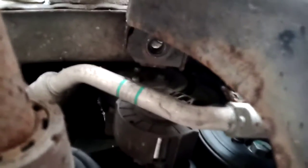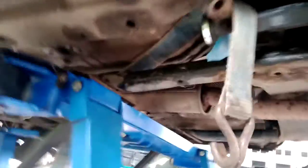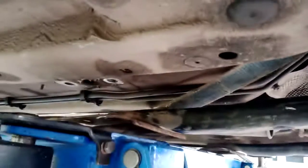You can just about see the hole there — where my finger is — there's a bolt that goes vertically up into the front inner wing, one on each side. Then around here there's a plate with three or four bolts holding that rear section up — you'll see it clearly when you go underneath. So you take all those bolts out and the whole subframe becomes floppy and loose. Be careful up here — the steering rack comes through the bulkhead at the knuckle joint. That's about as far as you can get it without causing damage, but it enables you to drop the whole thing two or three inches. Just be careful not to pull the steering rack out too far otherwise you will damage it.